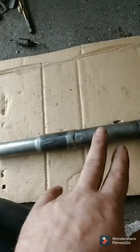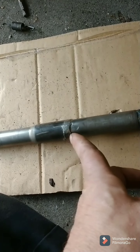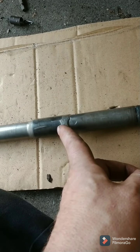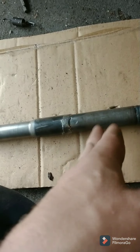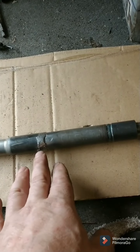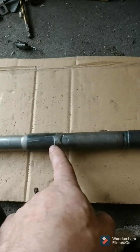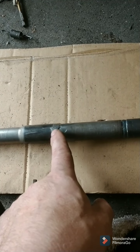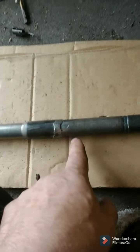When you cut these both off, you have to go in a half inch. So what I did is we went in a half inch and bored it out. It doesn't matter what size it really is, but you want to make it so obviously one isn't too thin and too thick, because they're close to the same size, these two. The original one, the Festiva one, is actually a little bit bigger than the Toyota one. So I had to grind this one down more and grind this one just enough. I had more than 100 thousandths wall on both of them.